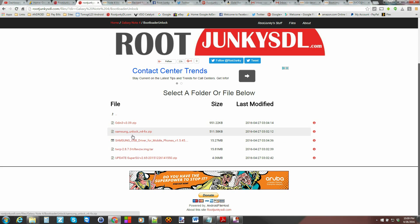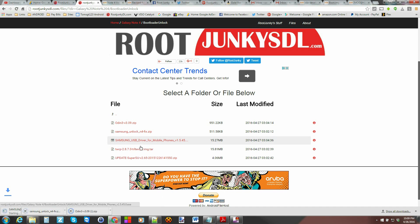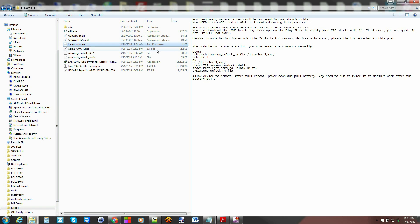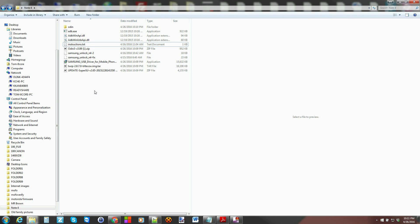You just click on them and download them, then take all of these and put them in the exact same folder on your desktop. Here's what they should look like: you have your drivers, your TWRP recovery image, your SuperSU file for getting root access, Odin so you can flash the recovery once we get to that step, your ADB files, and your Samsung unlock Note 4 files. I also typed up the directions so you can open this text document and see all the commands and code.